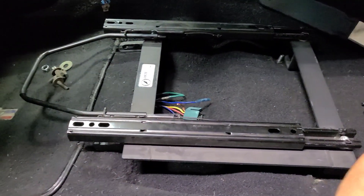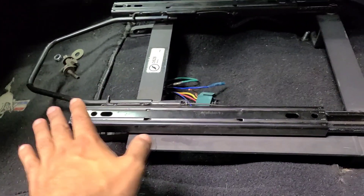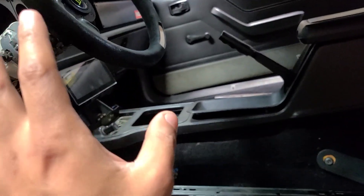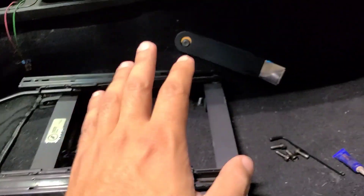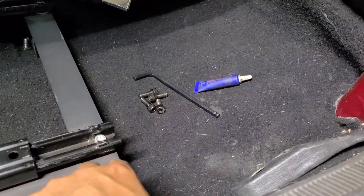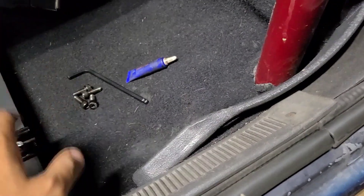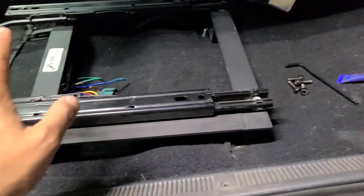After cleaning up the car and getting our hardware together, here is the seat base. This is a separate item sold by Corbeau, specifically for the Fox body to make it adjustable as well. I'm not a huge fan of having a fixed seat because having adjustability makes it a whole lot easier, especially when you've got an aftermarket steering wheel or even a door bar — you can scoot the seat back right before you get out. For the hardware, I am going to be adding a little bit of red Loctite because I do not want these things ever coming loose on me, especially not on track.